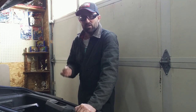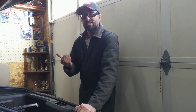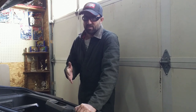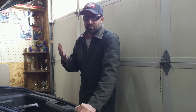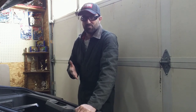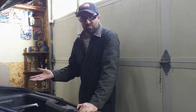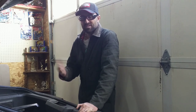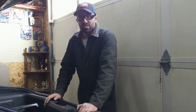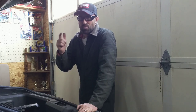Now the kit I did buy does come with window run rubbers, but at this point I'm not going to put those on. It's a little bit different, a little bit more involved, and I don't really have the space to store parts — because when I take stuff off, I don't want to have to put it right back on to take it back off later for the vinyl wrap. So I'm going to leave those for now. You've already seen it done on the wide body, so if you have any questions, I'll throw a link up to putting those in. But that's it guys — that's putting in door seals and a hatchback seal. The hatch and the trunk are pretty much the same, other than you need to take panels loose in order to get it on the hatchback. Making sure the tip of it points out is the same on the coupe or the hatchback. If you have any questions, drop them down in the comments or send me a private message over on Instagram or Facebook. Otherwise guys, keep modifying those Mustangs, keep making them great again, and I will see you next time. So Basin Motorsports and Kanan, we're out.